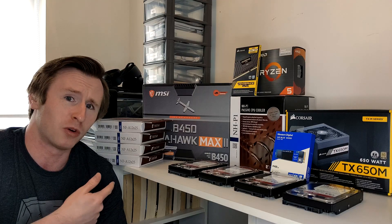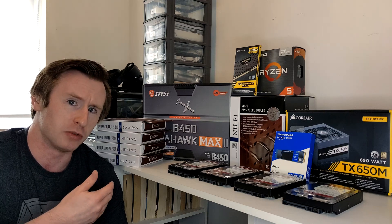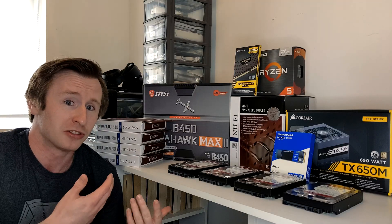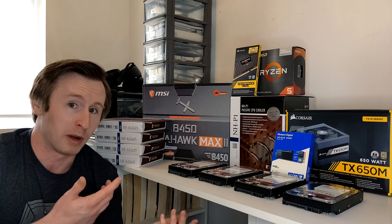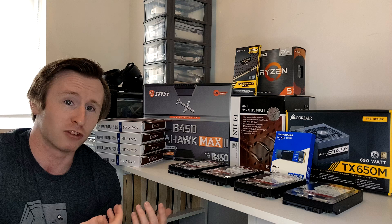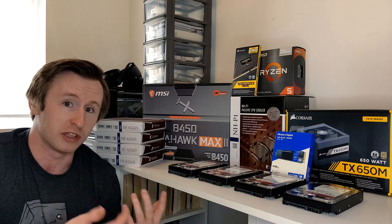All of this is going in the MSI B450 Tomahawk Max 2. You may be wondering why I'm pairing a Ryzen 5000 series CPU with a B450 motherboard — surely I'd be missing out on PCIe Gen 4. Well, the Ryzen 5000 G-series CPUs only support PCIe Gen 3, so going B550 wouldn't offer much benefit, especially when a FreeNAS wouldn't demand much of it. Also, this B450 board was really cheap — on sale for £60 — and it can accommodate all the storage devices we have.